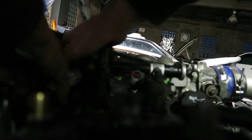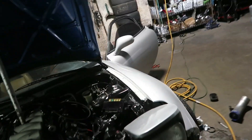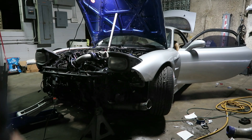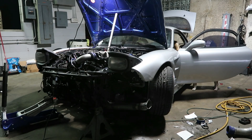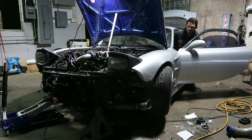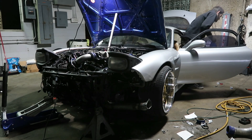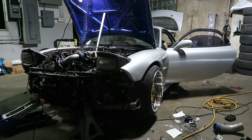I'm going to unplug these coilpacks so I can crank it over and make sure it's not going to be spitting fuel out. Because I really don't want this thing running if it's spewing gas everywhere. We're going to see if it runs — no fuel leaks. Be ready with the water. I've got my coilpacks back in, and it cranks further without coilpacks. It's not smoking as much — that makes me nervous. We're going to start.